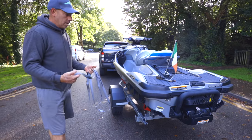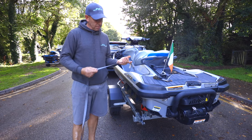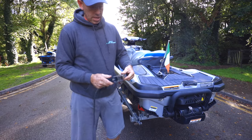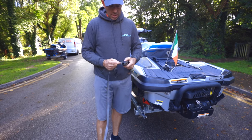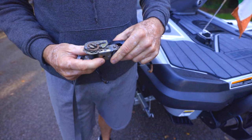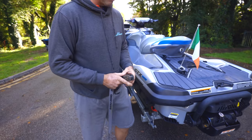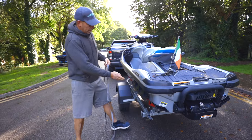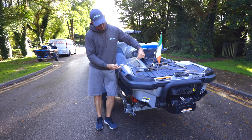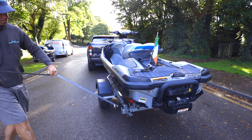At the back of the ski, the most important feature for securing it onto your trailer is the back ratchet strap. Make sure you get a good one — we have a Sea-Doo one here that the main dealers are giving out. Make sure the ratchet itself is strong; the cheaper ones will fail on the connectors when they come under force and bend. If they get stiff from salt over time, just put a bit of oil on them. A lot of guys will put the strap up over the ski — from a safety point of view that's okay, but over time it'll mark your ski and can damage decals.